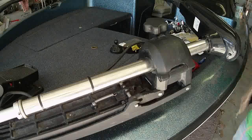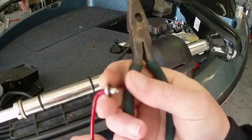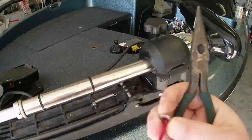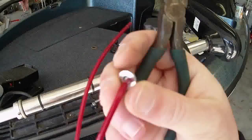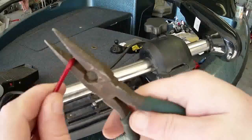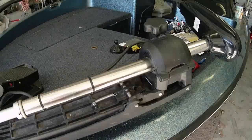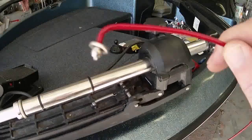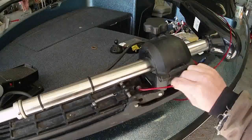What you want to do is put one of the washers on — slide it on the open end of the cable, the end without the ball. It comes with two washers, a smaller one and a bigger one. I'm just going to use the smaller one. You slide that on. What I did on my cable is I took a pair of pliers and bent that cable at a 90-degree angle, because that's about a quarter inch space in there. That way it'll just kind of sit in there and be able to pull straight.